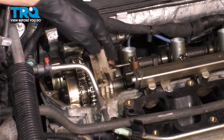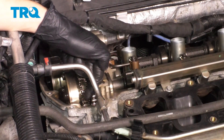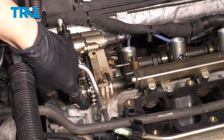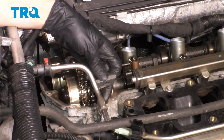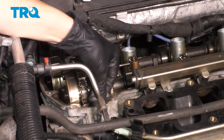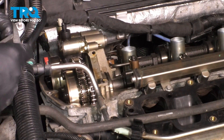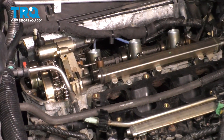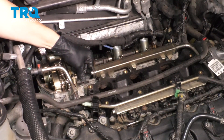Before the valve cover goes on, we have to clean up the surface of the head. This is very clean actually, but there is some corrosion and debris built up around where the gasket goes and I don't want this potentially getting under the gasket as we slide it on. Also in this area where the head and the timing cover are split, there is some existing RTV which we'll have to scrape off. I recommend a razor blade because you can easily peel it off and get it nice and clean. Try not to scrape anything into the engine — if a little bit falls down it's not the end of the world, but obviously try to avoid it. Scrape away from the engine — it's never going to look perfect, but clean it up the best you can.